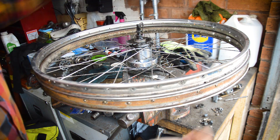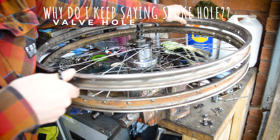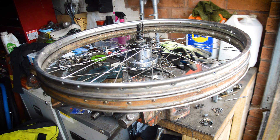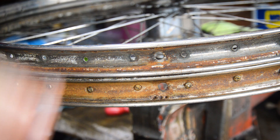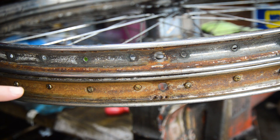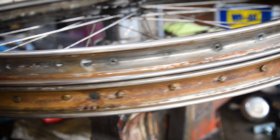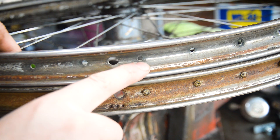The spoke hole is at this side, so I'm going to line my spoke hole up. Let's have a quick look at the drilling of the rim. You notice with most rims they are drilled off-center — you can vaguely see the centerline of the rim, and some of these holes are below and some are above, so it's about working out which ones are which. I think it's clear to see there's this bright stripe running around which we can use as a reference.